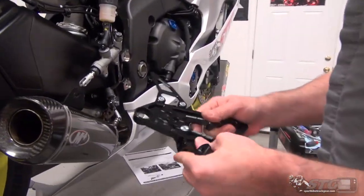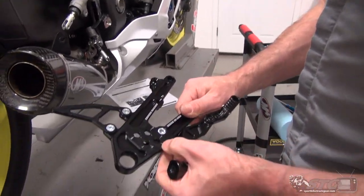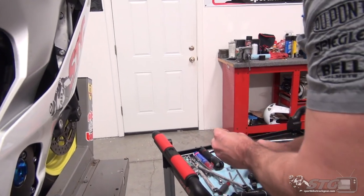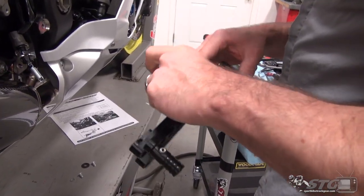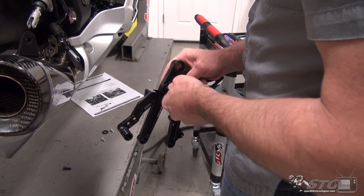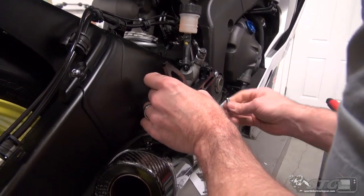Check all the fasteners — everything's good to go. Make sure the pedal moves freely. Now let's choose a location for our foot peg. The R6 comes with an aggressive stock position, so we're going to go zero and zero — put it right at the stock location for Ryan. If he wants something different, he can make that change down the road. We're going to put a little bit of thread locker on the bolt, slide it through, and not tighten this up yet — just get it started. Then we're going to mock the rear set up on the bike before I tighten it, so I can make sure I'm going to have a nice flat foot peg.